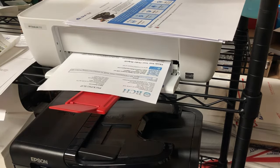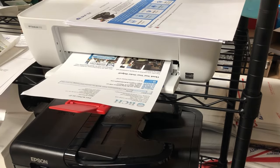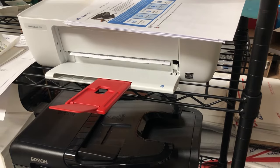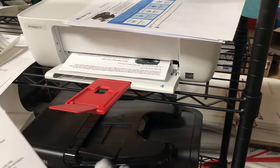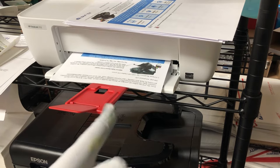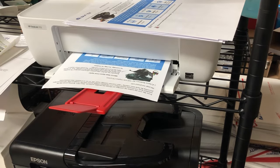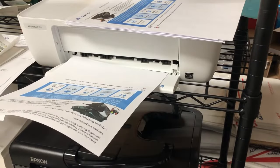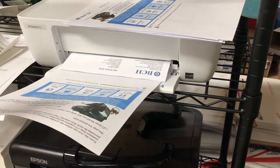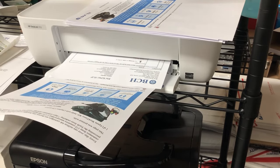Oh, we got some sign now. Good. More pages. You can see all the color is perfect after the third page. You can see there's some ink leaking. Don't worry, just print a couple pages, see what's going on. And see? Basically, we didn't do anything, and it just fixed itself. So what you saw is just ink coming down to the cartridge. You need to give it a little bit of time for your newly refilled ink to come down.